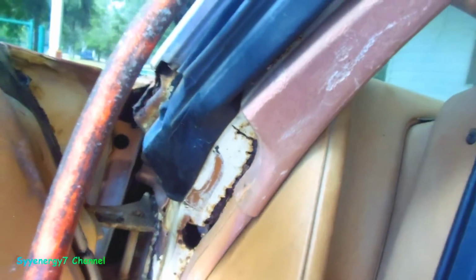The next thing, I picked up a die grinder, because when I pull off this plastic, I'm not going to pull off the dash. I'm going to put a piece of cardboard over the dash. I don't know if I'll be able to weld on the one side next to the dash, but I'll be able to weld all the way up and down on the opposite side and across. Maybe there'll have to be a bead of panel adhesive on there, but that's not really a problem, because I'm going to be putting in some new metal with mostly welding, and it might have a couple tacks along there anyway.